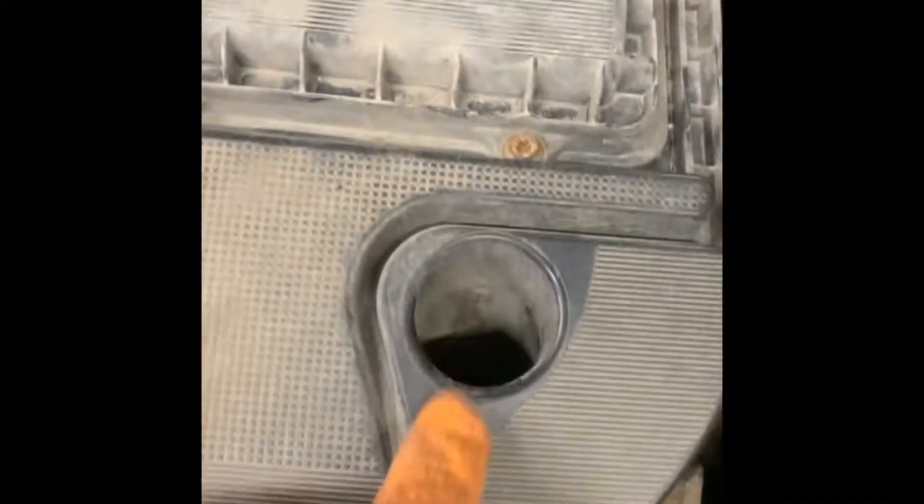You'll need to pull up — there's a rubber tab there, underneath, and there's also one on the back facing this way. So you'll need to pull up towards you, otherwise it'll break something. Pull it away and take the whole airbox assembly out as one unit.